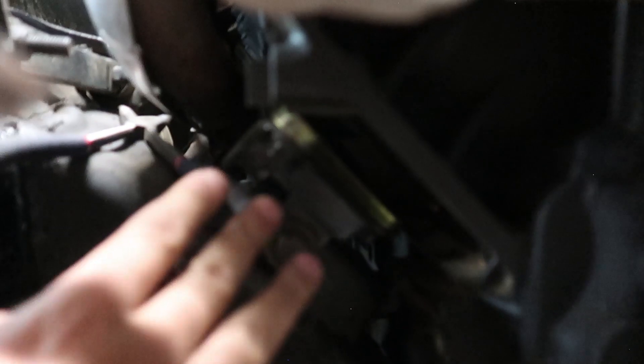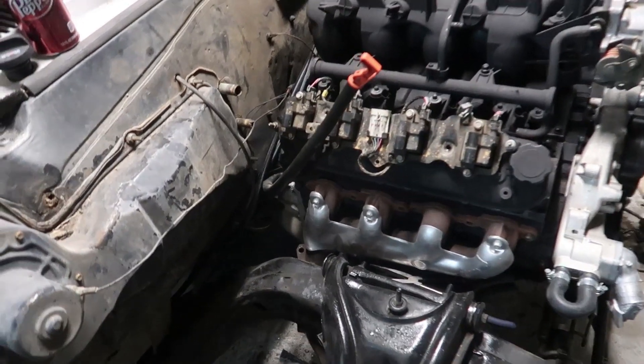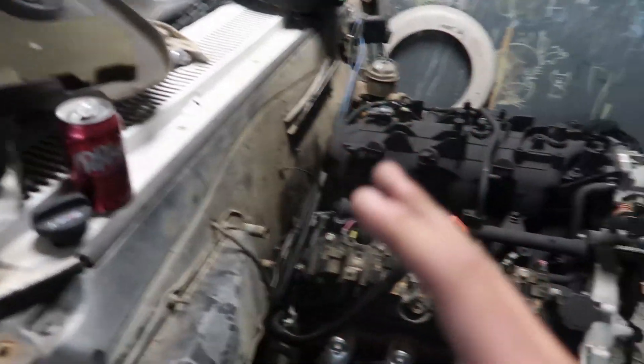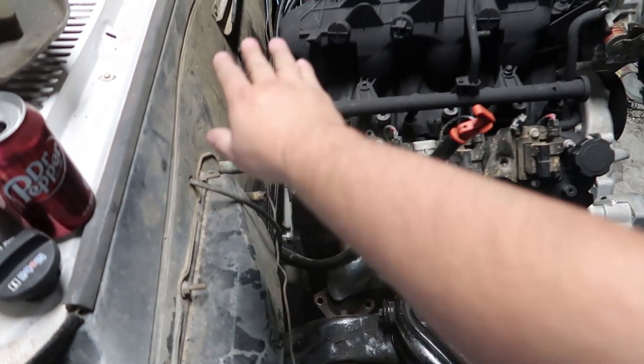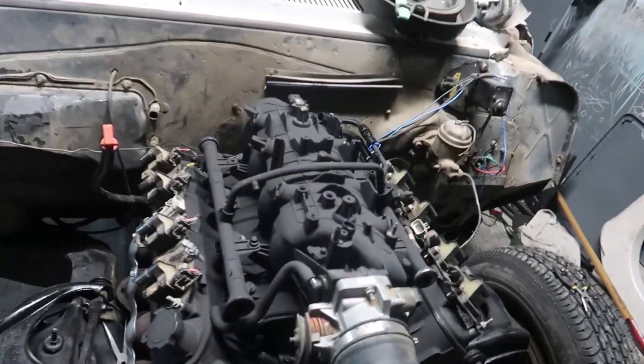I'm going to try my best to show you guys real quickly — it's a little dark but bear with me. This right here is the small block Chevy part, and you can see the gold part — those are the exact same motor mounts I just showed you at the table. They're a clamshell style; you keep pretty much all the parts from the small block Chevy. They have a bolt that passes through them, and once that's lined up you pass the bolt through, bolt it in, and it's pretty much good to go. This LS engine sits pretty much exactly where you'd want it to. This is a '65 Chevelle, and you can see I have some decent clearance to the firewall. I think I could scoot the engine back a little bit, but I like it where it is.